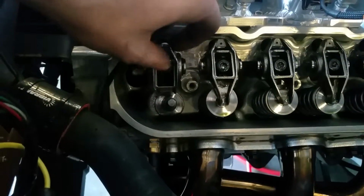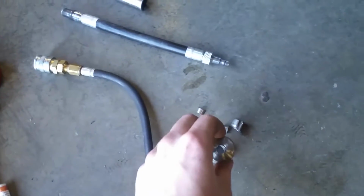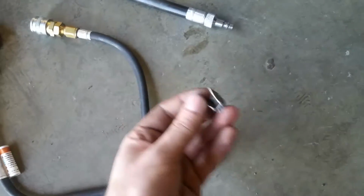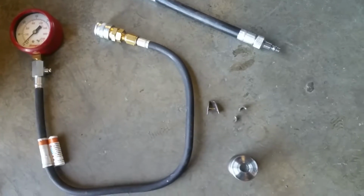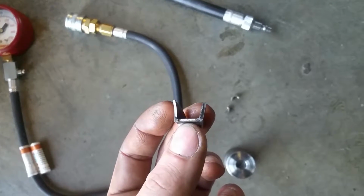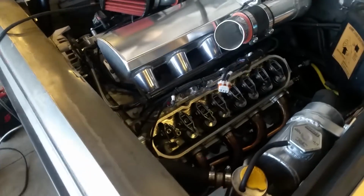Because of that, the valve, or the seat, came unhooked from the springs. The keepers were sitting inside the valve cover. There's the end of the broken rocker arm. So basically, the rocker arm is a Chinese knockoff of an LS3 rocker arm. Not a good part. Clearly not very big, not very strong. Snapped off, valve dropped, smashed into the piston.